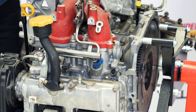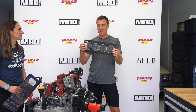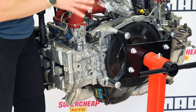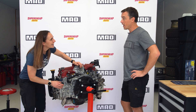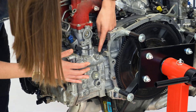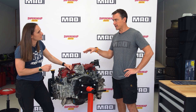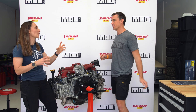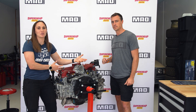So what does the gasket do? It's essentially a glorified seal — like an O-ring or a washer. It basically forms a sealing surface between two components. It's a very intricate and complex thing, but it does basically that job — it's a seal. Two of the major components of the engine are the block, the main body, and the head. On the Subaru, you've got two heads because two's better than one. The gasket goes in between the head and the block, and that's the bit that fails when you need a head gasket replacing.